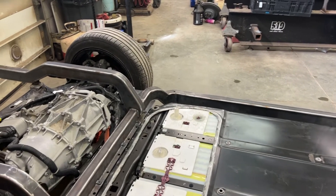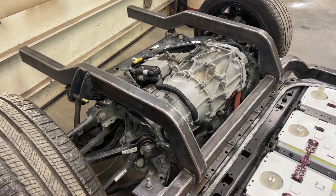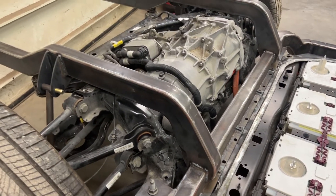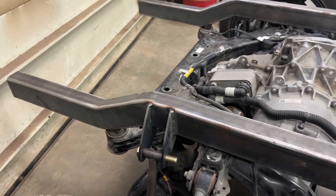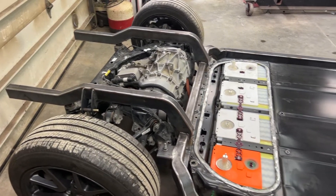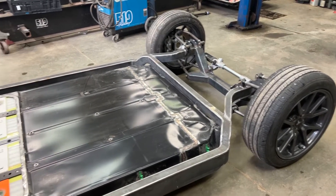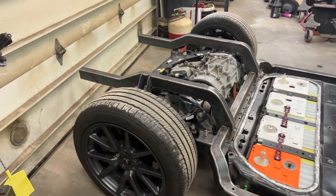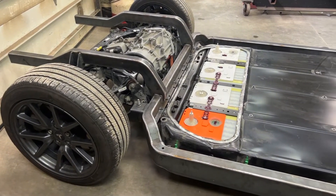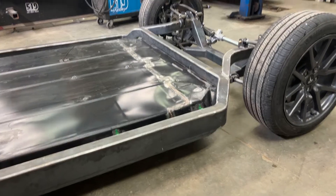This is a complete Model 3 rear drive — I'm using the entire Tesla cradle in the rear, so this uses Tesla CVs and all the Tesla geometry. But I am respringing it with a hot rod coilover, so this uses coilover suspension front and rear. One of the major benefits to that is once I have the car fully assembled and pretty much fully done, it gets scaled — corner weights taken — then I can order springs based off actual corner weights so we get the best ride and best handling possible out of this thing.